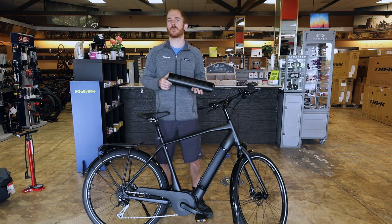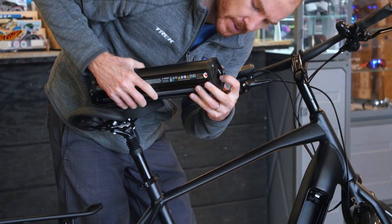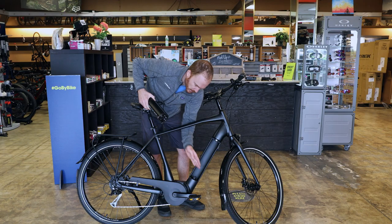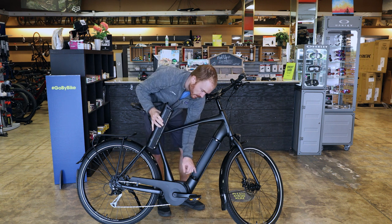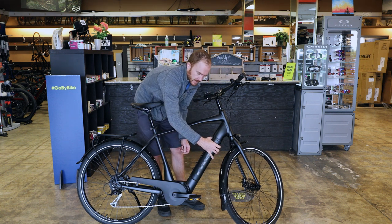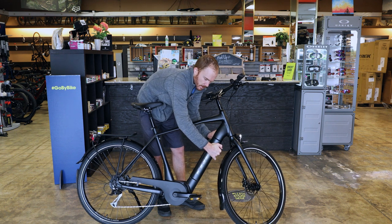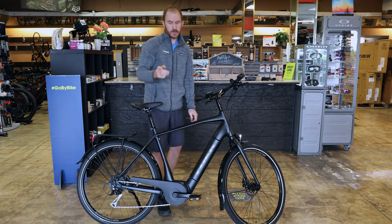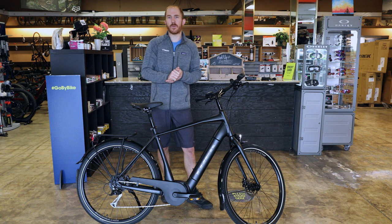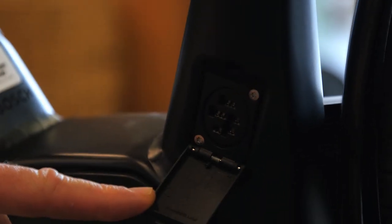They're super durable and we've had a great experience in store with Bosch. To put the battery back on, there's a small hole and a guide that lets you aim the battery in properly. You don't want to jam it in because there are metal tabs you can bend — softly set it in, then press down on the carry handle and turn the key backwards all the way. Press down on the battery, go forward with the key, and it'll stay locked. If you don't want to remove the battery to charge, there's also a port on the left side of the bike where you can plug directly in.